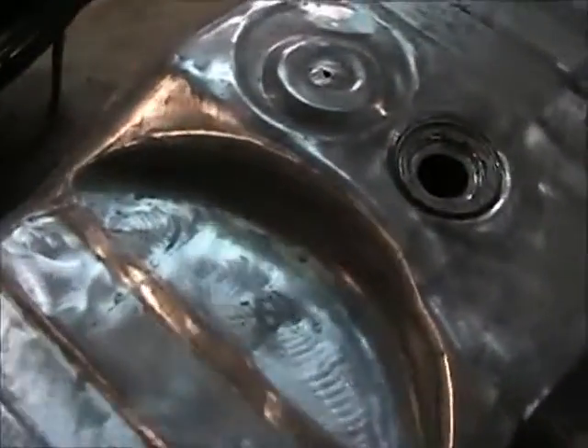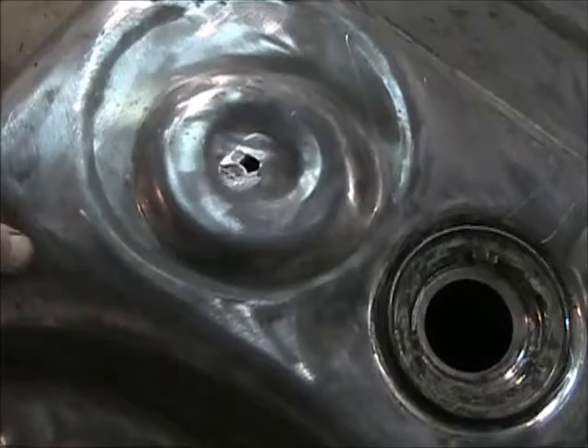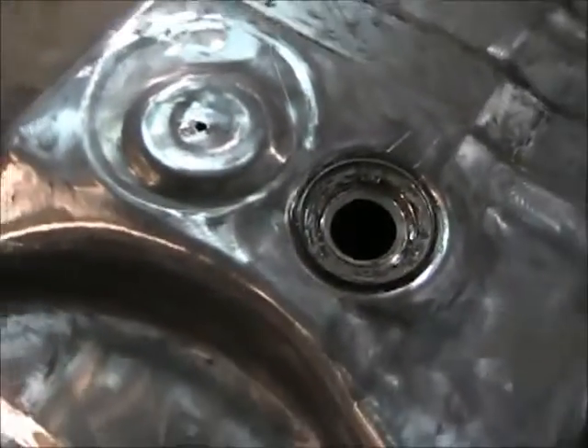I got her scraped down because I got to solder in a new return pipe, and I got to get a new sending unit anyway, so I thought I'd clean her up best I could. I actually had some dents in it and took them out — one I couldn't get out, right there. But got to clean that up a little more.